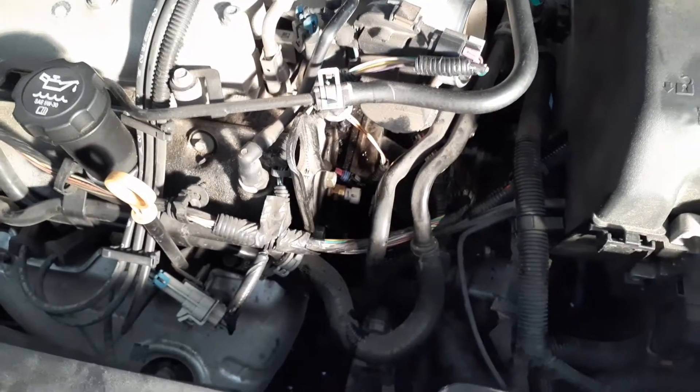So you just loosen that up right there, and you got to take this wire off here. That'll plug in here. I'm going to see if that'll do the job. If not, I have to change the thermostat — just be aware that coolant's going to come out. You can see all the coolant; it only came out a little bit, so I might just have to top off a little bit.